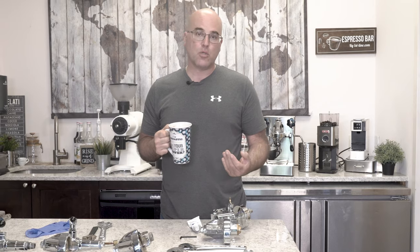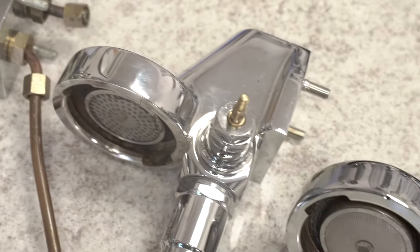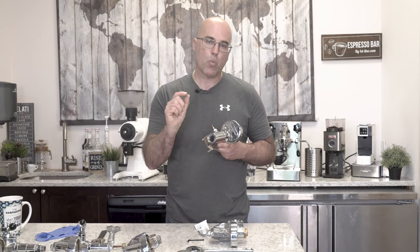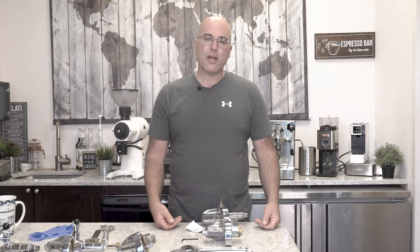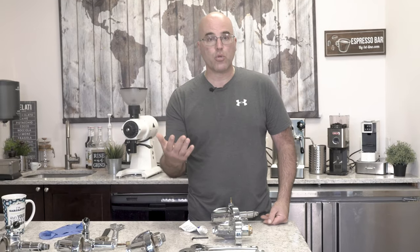On the table here we have multiple versions of E61s. Many in the industry may not realize they're actually a little different — there are slight design differences. For example, the area on top where the mushroom goes can be just a hair wider or narrower depending on the manufacturer. The E61 was originally designed by Faema, and there have been offshoots in Italy as well as Spain where these are being reproduced aftermarket and sold as E61. That's why you typically won't see a Faema E61 group head labeled as such in recent years.